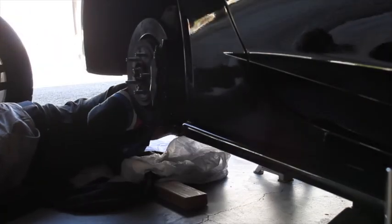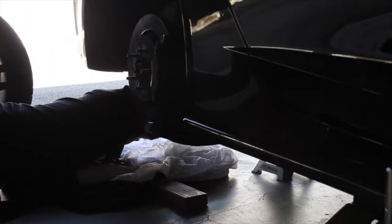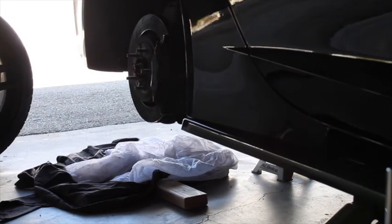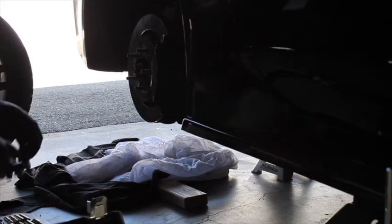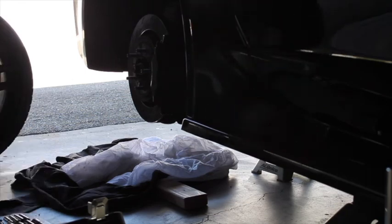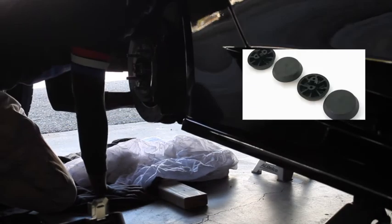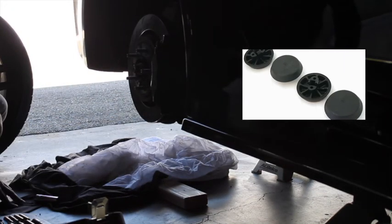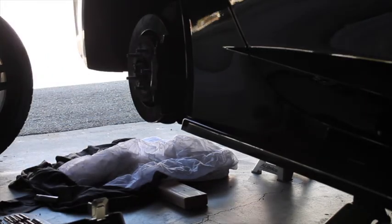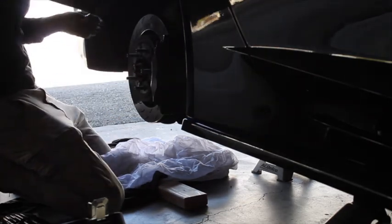So I use the side jack points to jack it up. Just a word to the wise, if you're gonna use the side jack points, make sure that you have pucks. You can get them online for maybe 15 bucks, I think. I got them off of Amazon. I'll put the link in the description. If you don't use pucks, then you run the risk of damaging the side or the undercarriage, especially if you have those side skirts on. So definitely put the pucks on. You put them on once, you never have to put them on again. They stay underneath the car. Plastic, works great. But I'll leave the link in the description. Definitely get you some pucks.